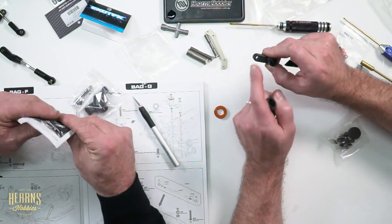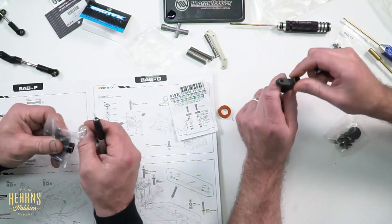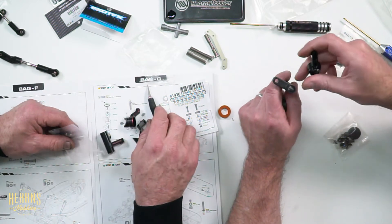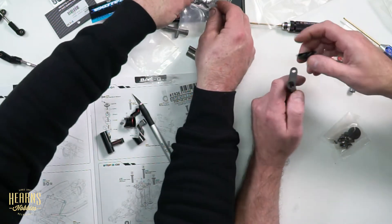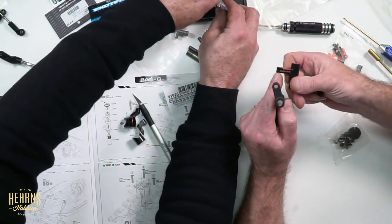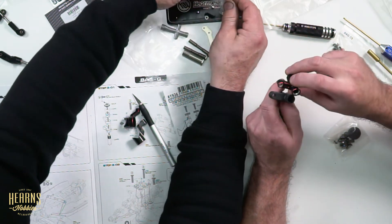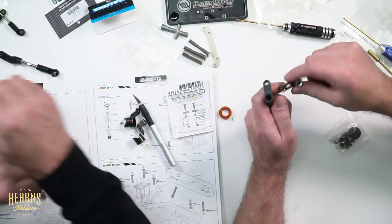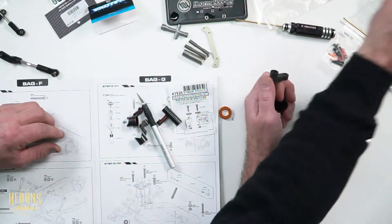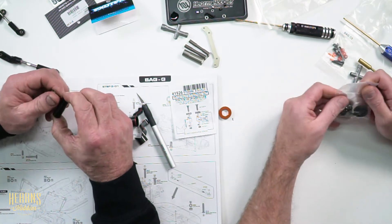Now there's nothing wrong with these parts, but they actually use an alloy bush in the steering rack here. The old alloy bush in the steering rack - that's not only common to HB and it's really robust, that does not break. But it can also get a bit of slop in it. These ones here are actually ball-raced, so we've got two little tiny bearings top and bottom. It's not for somebody who likes to use compressed air or Simple Green on their cars - you just blow it straight into the little metal shield bearing and then the bearing seizes and you have really crappy steering.